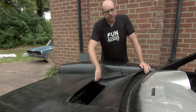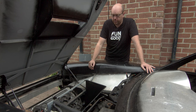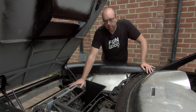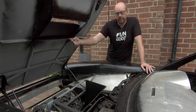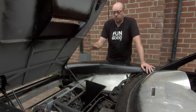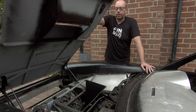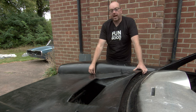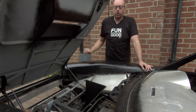We did a lot of modification under the bonnet last night. We ended up chopping out both of these side spars — we didn't need them. There's no flex anywhere, so we definitely didn't need them. For this centre spar, I think we were a little bit optimistic about how much space we still had above it. Considering it was put in expressly to support the underside of the bonnet, we ended up having to channel two little gaps out for these longitudinal spars on the bonnet to drop into, to actually give us enough drop to make any noticeable difference. But when you close the bonnet now it sits a lot lower — we've dropped it a good 4 or 5 mm, at least maybe a little bit more, which is great news.